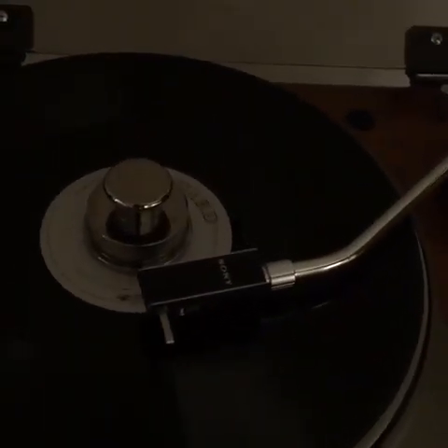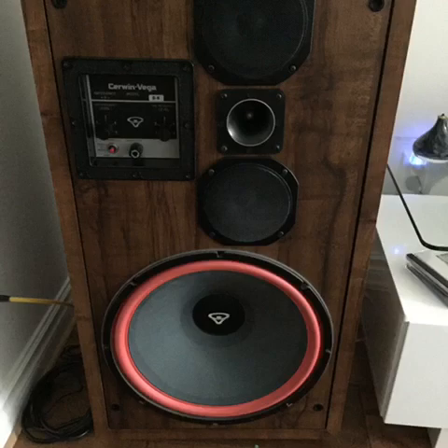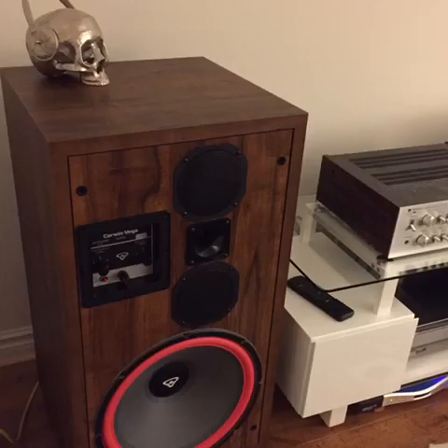So what can you expect with service on the Cerwin-Vega D9? If you're looking for a pair, there are a couple of things to consider. Obviously, the first is to look at the surrounds — if they're starting to look chalky, they're on their way out; if there are cracks, they're already past their prime. Also look for the tweeter. In one picture you can see a silver ring — that's the original D9 tweeter. The black tweeter is the replacement from companies like Simply Speakers. Some people say it's an upgrade because it takes off that edge the D9 can have when driven hard. However, it does sound a little different, especially at low volumes — it doesn't have the same brilliance. Also, this tweeter doesn't fit 100%; there's a tiny gap, so you may want to cut a foam gasket to seal the cabinet.